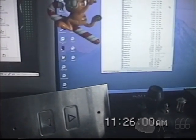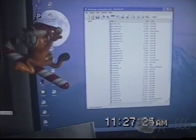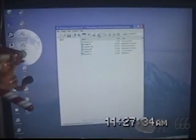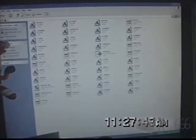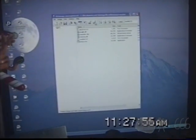That's actually a Windows 3.1 disk — I probably shouldn't format that. I just read the disk. Let's open up an image — how about the RAM Doubler image? We'll try to format and write. Actually, on second thought, I'm going to double-check this disk. I think this is actually the attempted video driver for the Corel 386. VGA logo, MMWD 480 — yeah, this is the Western Digital driver. So yeah, that can be formatted.